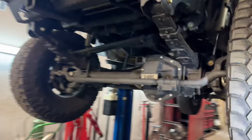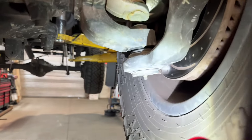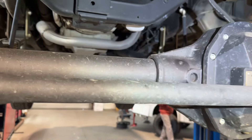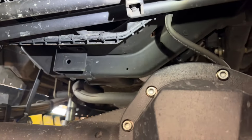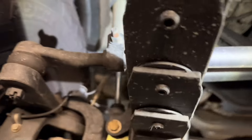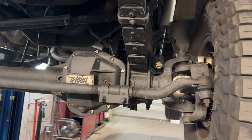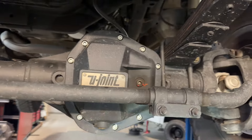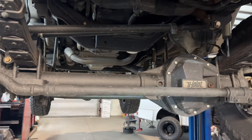Now that we're up in the air, we're going to do another visual check. We're doing an oil change and tire rotation on this rig right now. We're also going to grease it — the ball joints, the drag link ends, the tie rod ends, and the drive shafts. Check all the fittings; there's a grease fitting on the slip and on the CVs. If your steering wheel is off, it's super easy to fix — just loosen the drag link clamps and rotate the drag link until the steering wheel is straight. We're also going to check the diff fluids. We recommend changing your rear diff fluid about every 20,000 to 25,000 miles. The front diff doesn't see as much use, so I recommend 40,000 to 45,000 miles on that, along with the transmission fluid and the transfer case fluid.